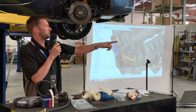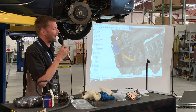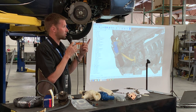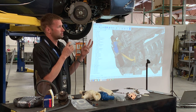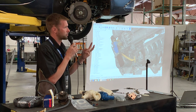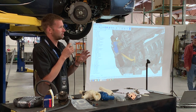I saw some other hands. The turbo adapter kit, is it going to be hard lines? No, it'll be silicone soft lines. We talked about that. Few different problems. For one, if it's a non-FM kit, a hardline kit won't work. It's going to be pretty close to the exhaust manifold, so the stainless would work really well, but it would also transfer heat really well, so we don't want to do that. And it's going to be a kind of convoluted routing in there.